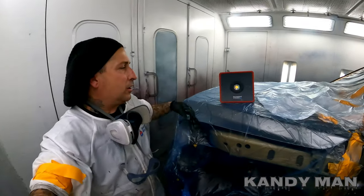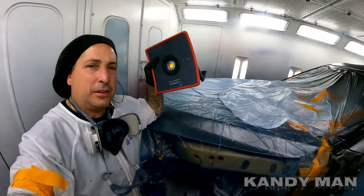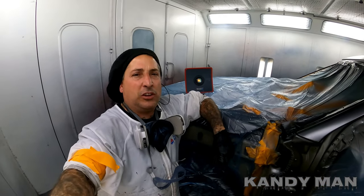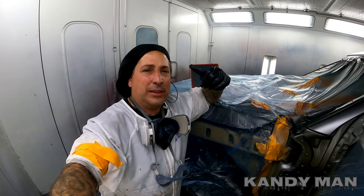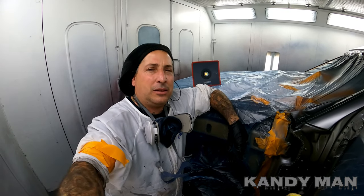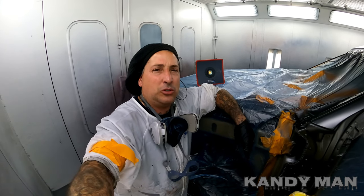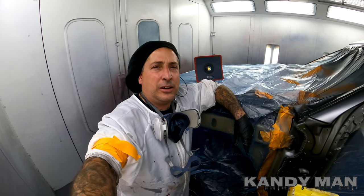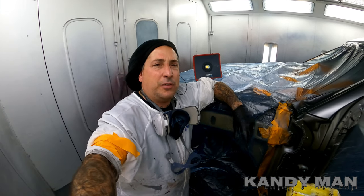Checked it in the dark with the scan grip, and this is the big one. This really works well on big panels like that roof. When you turn the lights off, you could really see it well with that big light. So it looks covered, and we're gonna go ahead and clear this one with the C2 on the DV1. So the C2 caps a little bit faster, and I like that better for when I'm up on the top of that roof.